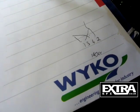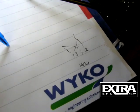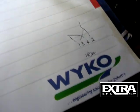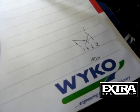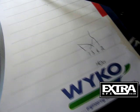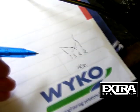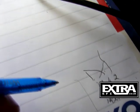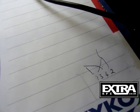On a six-cylinder or eight-cylinder - on a V6 or V8 for instance - just connect all the odd-numbered cylinders to bank one and all the even-numbered cylinders to injector bank two. On a straight six, look at the firing order and pick the cylinders that are opposite each other.